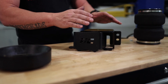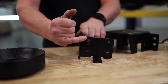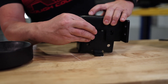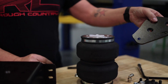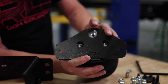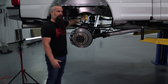Let's take a look at the bracketry for this F250/F350 specific kit. This is the lower mount bracketry — it is two-piece, and the reason is it's got multiple levels that you can mount the pad depending on what lift you have on the truck. In this application, we're going to pick the top portion of holes. Coming over this way, this is going to be our top mounting plate, and if you look, it's marked with a P for passenger side — they are side specific. This is going to mount on top of the bag and it's got a location for your airline. Once this is all bolted together, this whole unit will actually replace the factory bump stop, so it's really convenient.